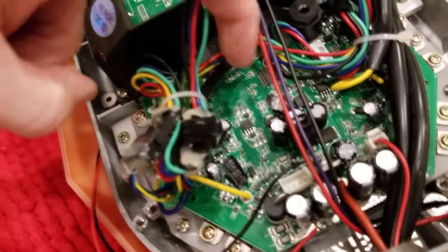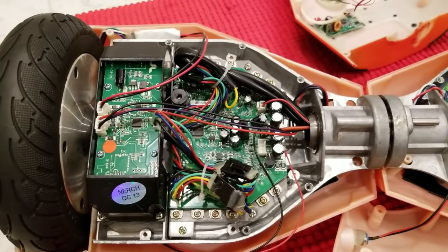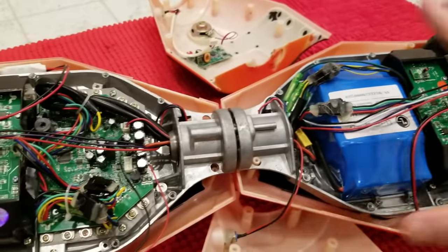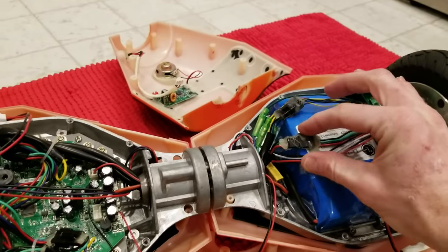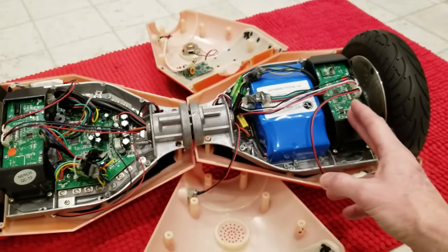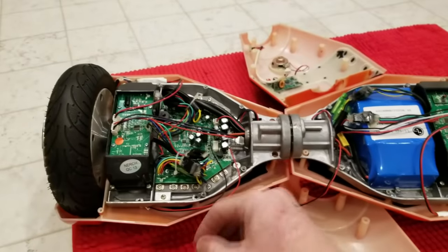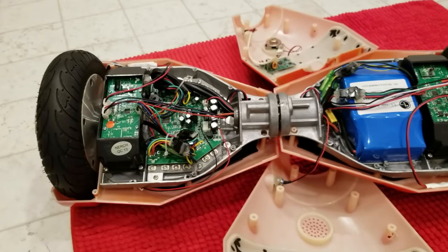I'm actually experiencing a very small red dot blinking light right where my fingernail is — I believe my issue is a bad motherboard. You can pick these up pretty cheap, though it's a pain because you have to disconnect all the wires, fish it through, unscrew everything, pull it out, and do it all over again — but that's the worst case scenario. On this side as well, make sure everything is attached nicely and tightly. If you don't see any loose connections, most likely it's a bad gyroscope board or a bad main board. I've found a few and will try to link them in the description — you can get a whole set: two gyroscopes, lights for the foot pads, and the main board for around twenty-six to thirty dollars.